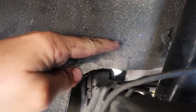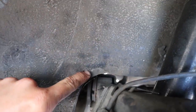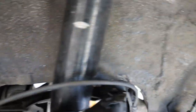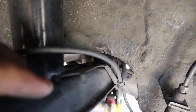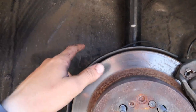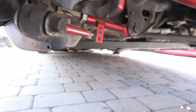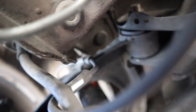What a lot of the dudes in Japan do is cut out this entire thing and go do some crazy stuff. For right now, I looked on the backside and it's kind of up to here where the pinch weld attaches and then folds down. The whole plan is to either just cut some of this out or actually cut the entire thing out. I may notch it on the outside so that the coilover can go up. First step I think I'm going to do is take off the SS kit, allow the entire knuckle to drop down — that'll give me space. I do have a metal sawzall as well as some cutoff wheels, but I just want to make sure that my rear upper can go higher so I can go lower.